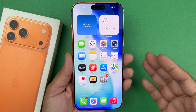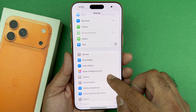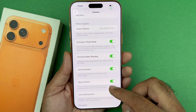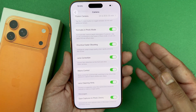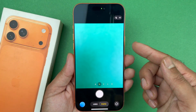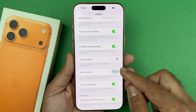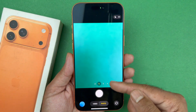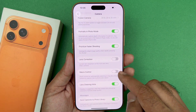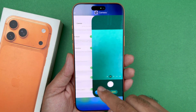The next thing is checking two settings. In your iPhone Settings, go to Camera and scroll down to these two settings. The first one is Lens Correction — by default this is turned on to correct lens distortion, so I would recommend turning it off and checking if the camera focus is better. Another setting you can turn off is Macro Control, as this switches your ultra-wide camera to do a macro shot, activating different lenses and causing it not to focus correctly. Try different combinations of these two settings to see which works best for your focus.